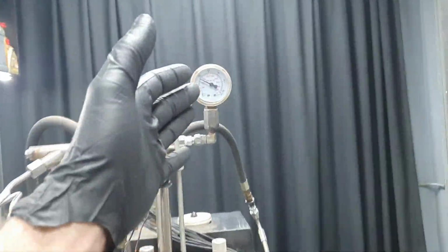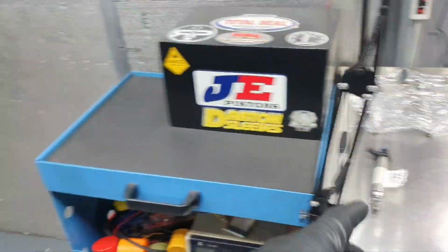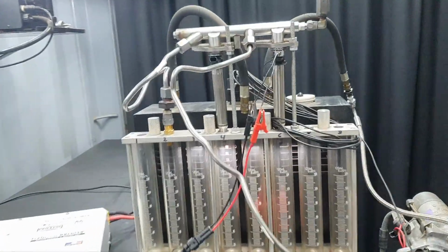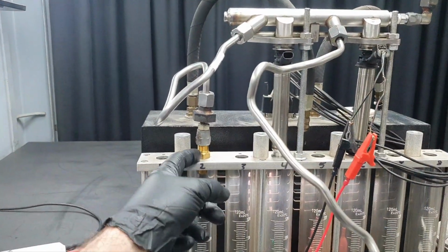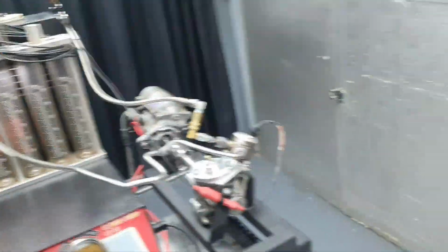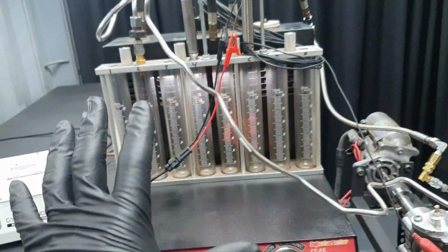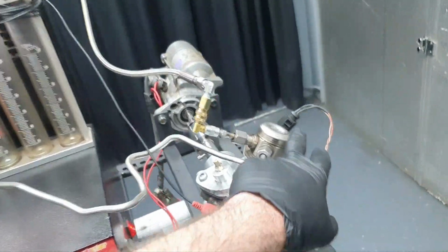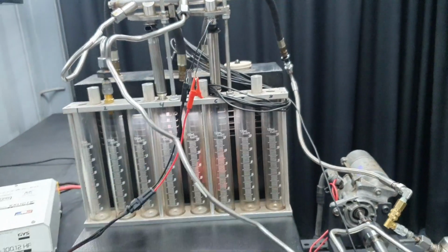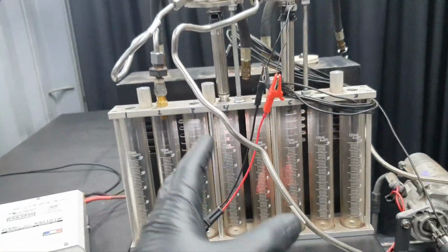I have to remove the pressure from here by activating the injector, and then I have to mount. I'm gonna mount this injector first, the one that's leaking. I just wanna see how it looks inside. I'm also gonna remove the check valve here, and I'm gonna check the injectors with this pump. This pump is almost new, and it's performing fine, beautiful. I have the readings from this pump with these two injectors. These injectors are not old ones, they have very low mileage, I think from the 90 thousand kilometer engine, something like that.